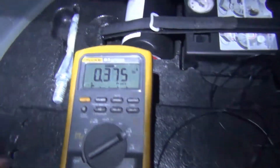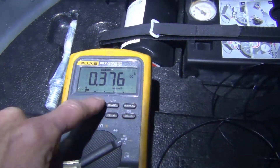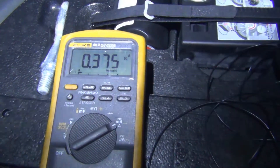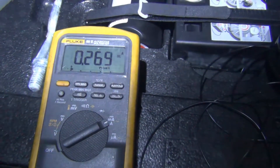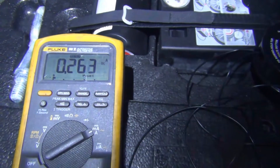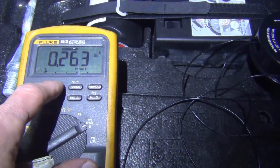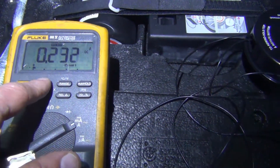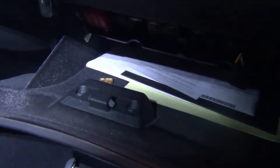Coming back to my meter — I currently have 375 and I'm just going to reset it. You reset it by pressing and holding the min-max, which shuts off the recording. I would have to wait half an hour to an hour for the car to go to sleep, then you come out and press your min-max button. What that's going to do is record the lowest and the highest — you just hit the button to scroll through: that's the max it saw, that's the minimum, and it gives you an average. Press and hold to reset. That's how you do a parasitic draw test.